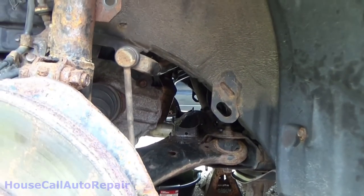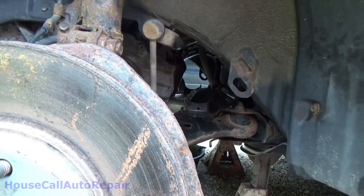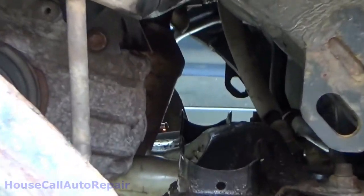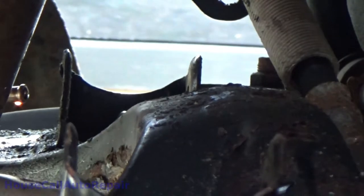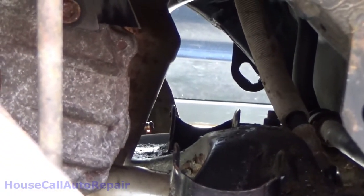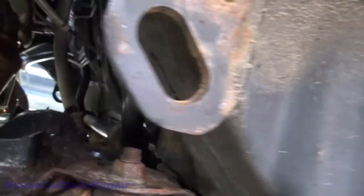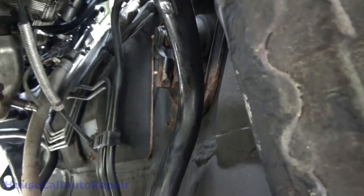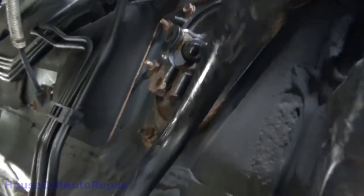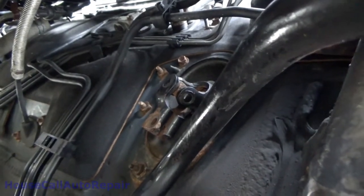Now the game plan here is to just take the rack and literally just walk it right in from this side and hopefully get it all the way down into all of its mounts over there and right here, and then there'll be just enough room in there to get the power steering lines hooked up. And let's see if I can get you in here. And there's their steering mechanism. Let's get the, there it is. Now we've got to connect it to the top of the rack.